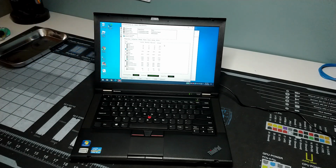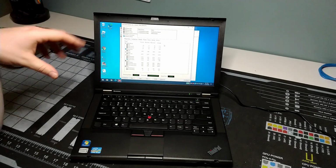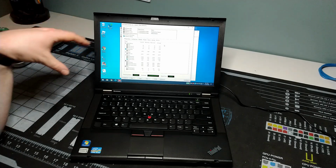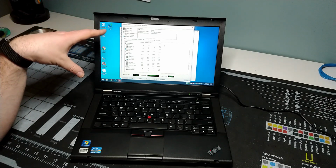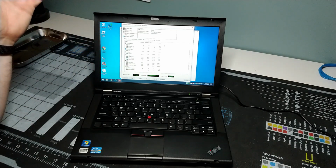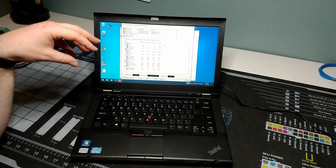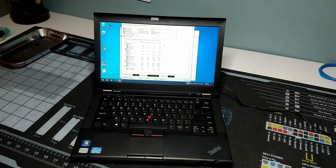You maybe want to diagnose to see if the fan is working properly, right? When it gets up to its maximum temperature, am I getting the 4,000 RPM or 4,200 RPM or whatever it is on this ThinkPad that it should be getting, or am I only spinning up to 2,400 RPM or something, or less than that, which tells me there's definitely something wrong with the fan. Maybe I need to replace it, or pull it out, take it apart, re-grease it, etc.